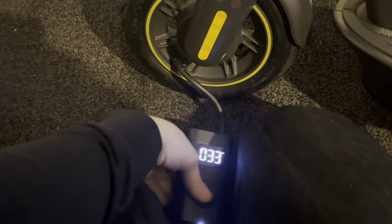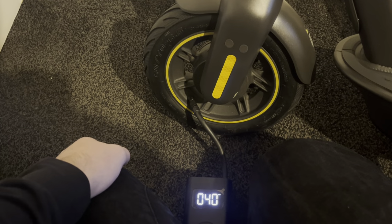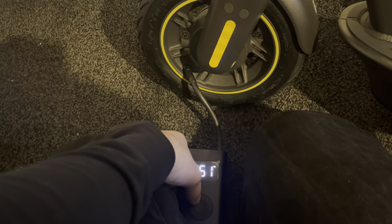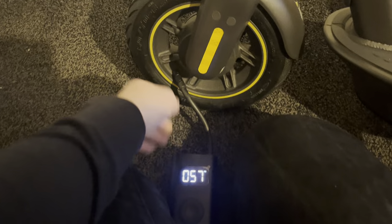33 PSI — wow, that's quite low. Let me use my other phone as a torch. Looking at the tire, it says 55 PSI — yeah, 55 PSI right there on the sidewall. Having only 33 PSI is definitely a lot lower than it should be, so let's give that some air. It's a little noisy but this is the quickest way to do it. Let's take it up a bit more and set it to 56 PSI.